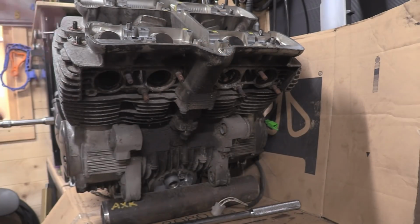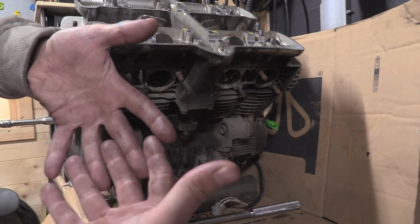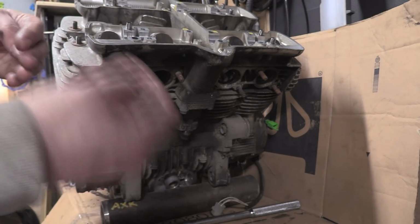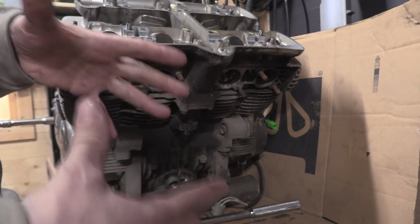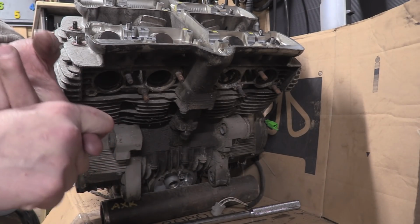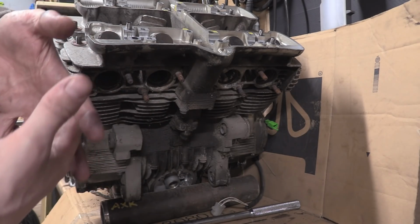So what's happening here is that the steel is expanding. It's crushing the rust. Then it shrinks back again. The rust is fucked. The volume it was trying to force against has now all been crushed and smashed up. So that's why you heat it up. The hotter you can heat it without damaging things, the more thermal expansion you're going to get.